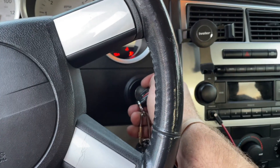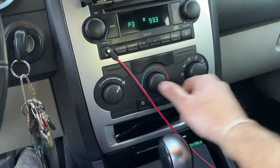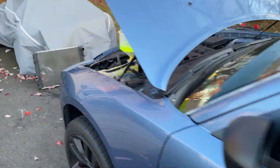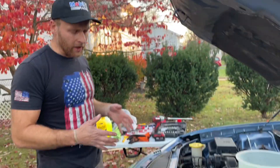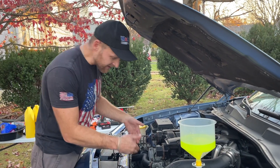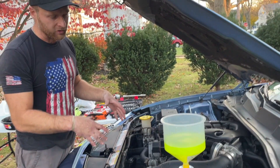Now what we're doing is starting the car. Turn the heat all the way on high and make sure your AC is off — the reason is if your AC is on, your fans will go on right away and we don't want that. Now it's a waiting game — we're heating up the car and we want the thermostat to open. We'll know it opens when the fans kick in, and then you're going to see it bubbling more because it starts sucking up more liquid into the engine.